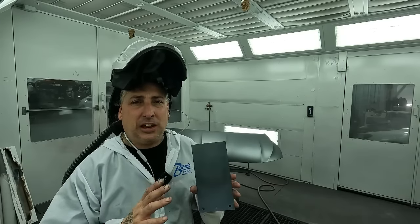That's one coat of clear. We're going to let that sit for about 10 to 15 minutes depending on the temperature you're spraying in. If it's very hot you can go in a little sooner, but make sure you get all the solvents out of that product before putting your second coat on, so you don't have any solvents trapped and you get your best gloss retention. If you're using a speed clear, some want you to do it back to back to get all the solvents out at once. Look up your TDS sheet — look up how they want you to apply it, what temperatures to spray at, what gun to use — and go accordingly. I'll bring you back and you'll see it all finished up.